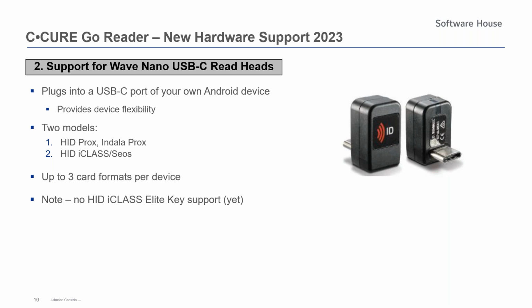Yeah, the basic card swipe, check the card, that is totally offline supported. The unit has a nice hefty database, up to 250,000 card holders. And then as you swipe the card, it buffers up those transactions. I believe it's up to 10,000. And then once you're online, it just shoves them back up to your server. And that's for checkpoint and for the mustering. Oh, the gate control has to be online. That's right, because you have to control the iStar, so you have to do that in real time. But the other modes are all available offline.